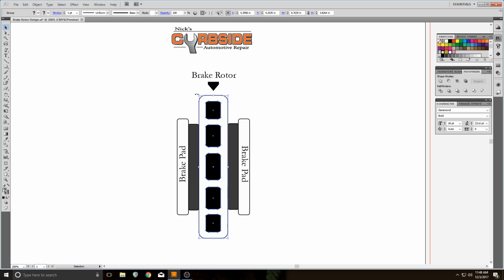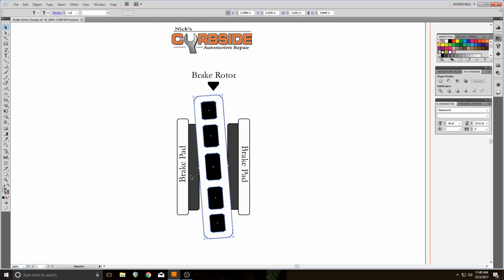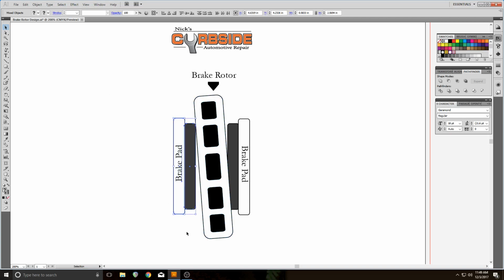Another reason I recommend you replace it instead of doing nothing, if you're warped like that, and now we're going to put a brand new brake pad on. So this is the new brake pad. We put it on and there's our warped rotor. As you can see, this is extreme, but you can see that the rotor is just wearing on this corner of this brake pad. So this is going to give you the possibility of having a squeak or a grinding noise. You could actually not have a pulsation to start with, and you put new pads on, and now you do have a pulsation. And it's going to cause premature wear of your new brake pads. So your brake job that you just had done is not going to last as long as it should have or could have.